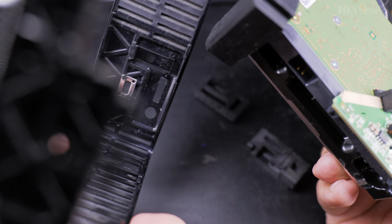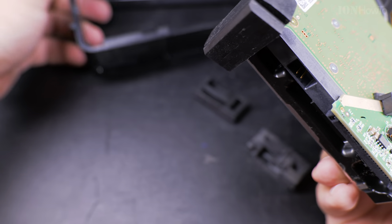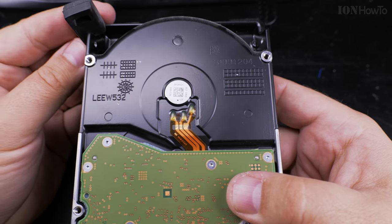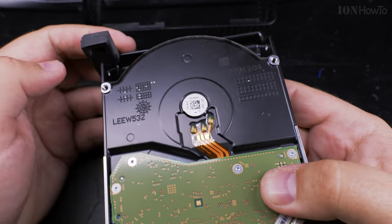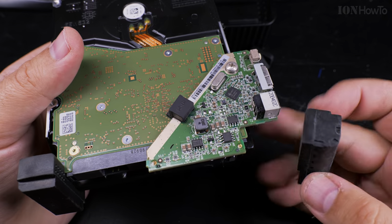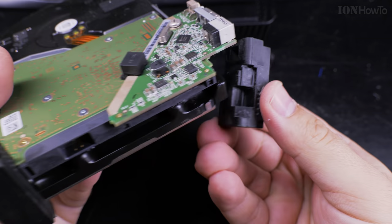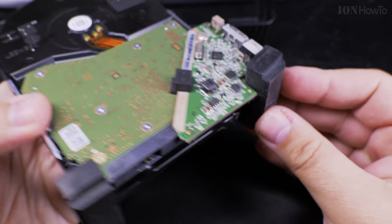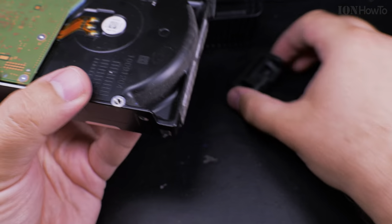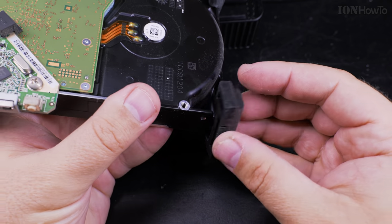You could put another drive inside the case, but you have to be careful. The shape of these grommets is only made to work with this shape of drive. I have another 8TB drive with a different shape, and I actually had to cut these grommets to make it fit, and it didn't fit great. It was enough to be able to insert it in the case. They changed the shape of these drives at the corners - on the newer drive the corners are shallower, while on the older 8TB drive they were a bit thicker. I guess they optimized the size of the drives.